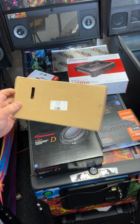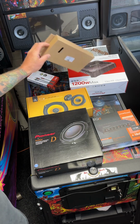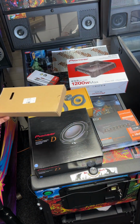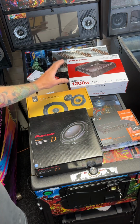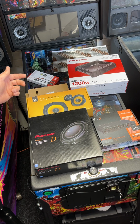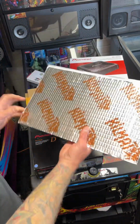So the 350, which is about 29 amps, and my amp is 30 amps, 30 amp fuse. I'm never going to use that on full power, so this was plenty. I'm probably pulling between 5 and 8 amps. With this, just a good quality amp that was able to give me the four channels. I've got the channel 1 and 2 for the back box, and then I've bridged 3 and 4 for the sub. And then this is some secondary Dynamat.